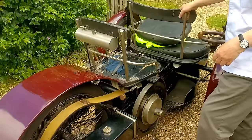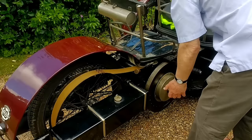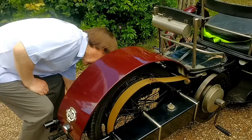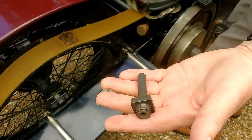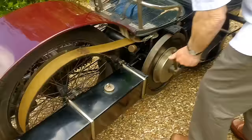It's become too advanced the ignition, because too much gas has heated up the rod. Do those rods used to be made of platinum in the early days? Platinum, yeah. Is that still platinum on your one? It's stainless steel. That's what it looks like — it just screws into the top of the head, just like a spark plug. It's hollow at the end. It's good that you carry a spare — you won't be getting those in your local garage.